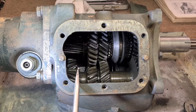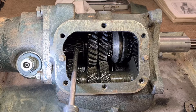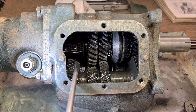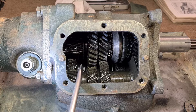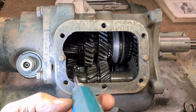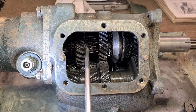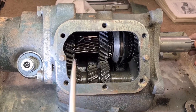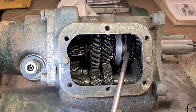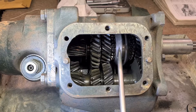Because these cars haven't got synchromesh on first gear, there's no synchro assembly on the first and reverse gear, so it simply slides in. When you press the clutch down this stops, and the shaft has stopped because you're not going anywhere - the wheels are stopped. They put a nice radius on here to enable that to go in without too much crunching. When it goes into reverse, this gear meshes onto this idler gear, which is permanently connected to the layshaft through this gear, and now it's in reverse.